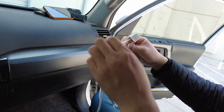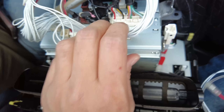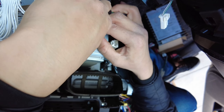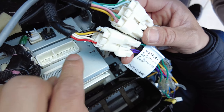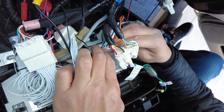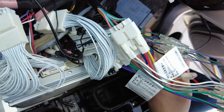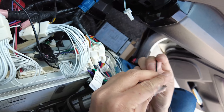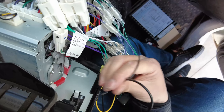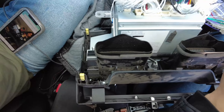We're going to plug those in — this is the main connector, and also this one here. So let's go ahead and unplug these two from the car side and connect them into our female harness. Then grab the male side of our harness and plug it into the factory radio. All we have to do now is ground these two negative ring terminals. I'll do it right here on the side — you can use any of the nearby bolts. I'm going to grab an 8mm, unscrew it, and screw the ring terminals in there.